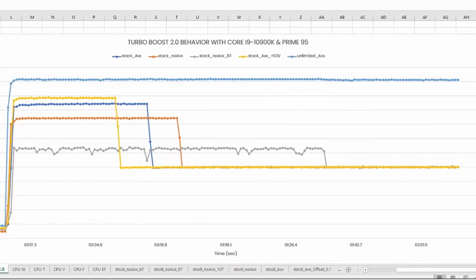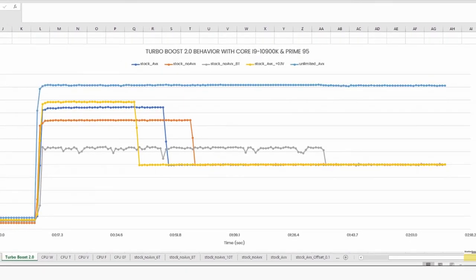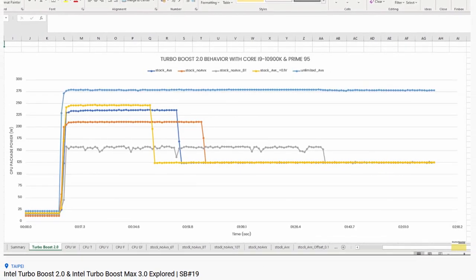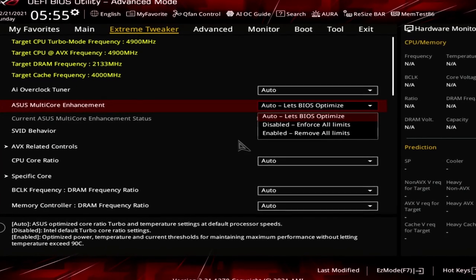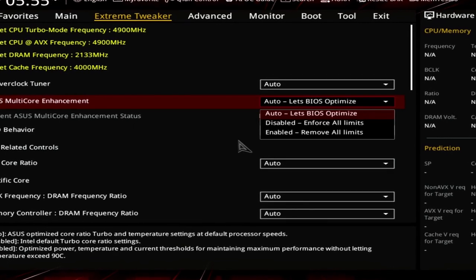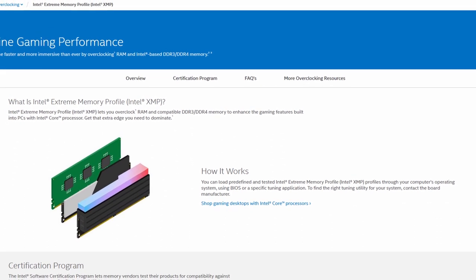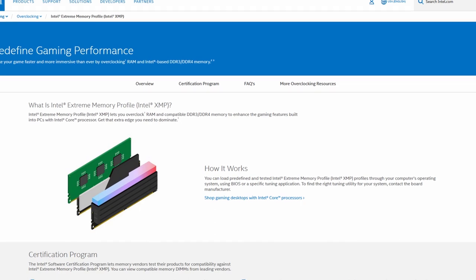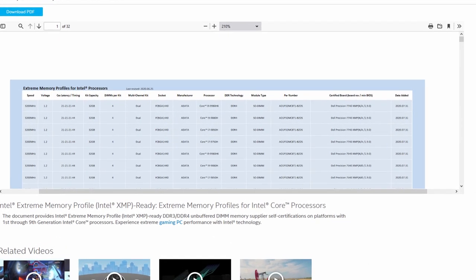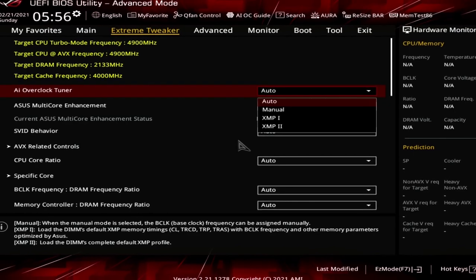While we use a different CPU, the Turbo Boost principles explained in that video also apply to our configuration. By unlocking all the power limits, we effectively tell the CPU to run at the highest possible Turbo Boost settings all the time. On the Maximus 13 Hero, the power limits are unlocked by default, so all we need to do is load the optimized defaults. We also enable XMP — Extreme Memory Profile — which allows memory vendors such as G.Skill to program higher performance settings onto the memory sticks, enabling higher performance with a single BIOS setting.